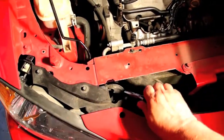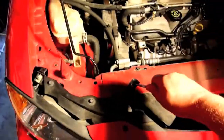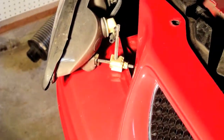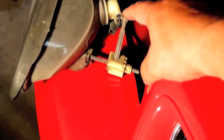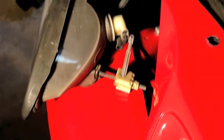To remove the shroud I found these two clips - there's one here and one here. You've probably got to use a small pair of pliers. It's kind of a spring steel clip and then you just pull them like that, and then the headlights come right out. This is different than what the instruction manual says, so you kind of need to pay attention to how this thing goes apart so you can get it back together. This thing can actually turn 360 degrees but it's got to be up because it fits into a slot here, and that adjusts the headlights.